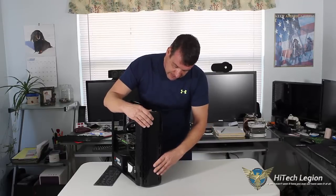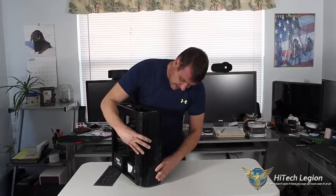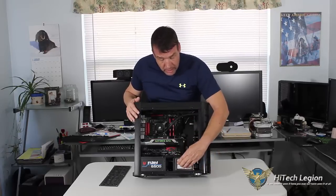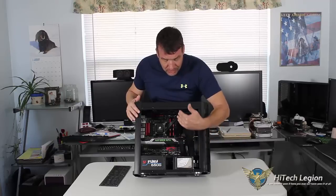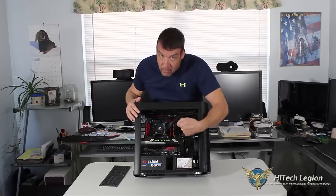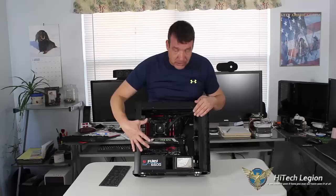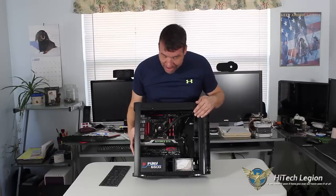As you can see, there's a nice amount of room to work with even with the AIO in here. It is pretty easy to get your hands underneath and get things plugged in, but you're going to want to put the wires in first, then wrap them through the grommets up on top, get them down inside, wrap them up, and get them underneath so you have room for cable management. We do have adequate airflow coming across the front of the case towards the back, and with the extra fan on top, we're getting a little more downward pressure to force the air out through the back.